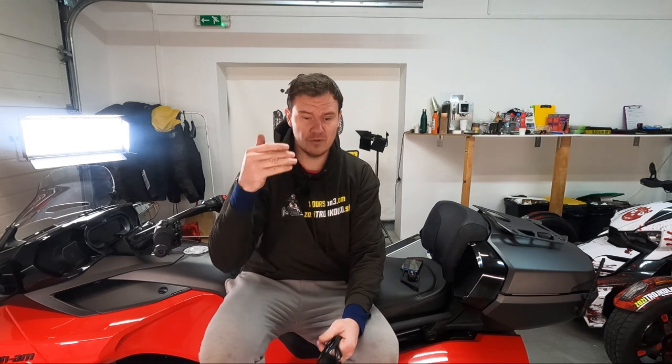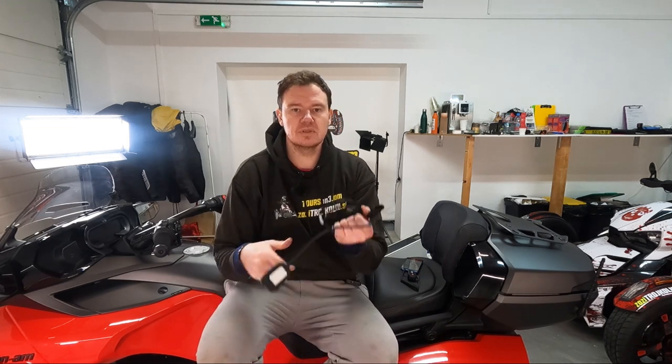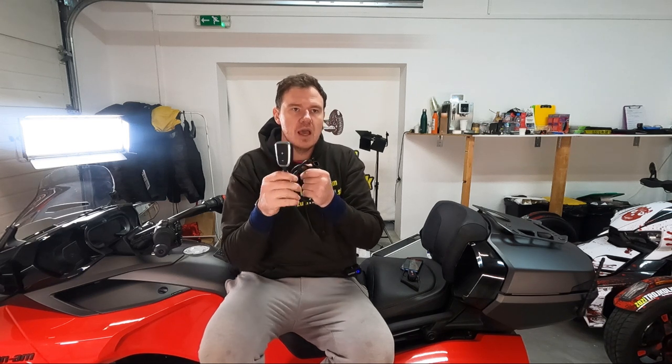They have an electronic throttle — that's why we have cables going from the throttle all the way to your ECU, and all the thinking happens in the bike. When you hit the throttle without a pedal box, your bike goes: okay, there is acceleration — probably accelerate, so I'll accelerate. With a direct cable, it would say accelerate and go to maximum engine output. This is possible to have with pedal box, giving you maximum output — and that magical number is 94.99%. We cannot go above that because the bike starts to throw error codes.